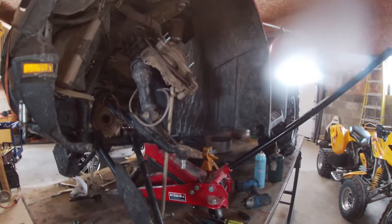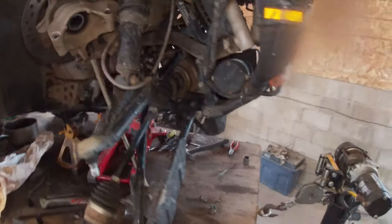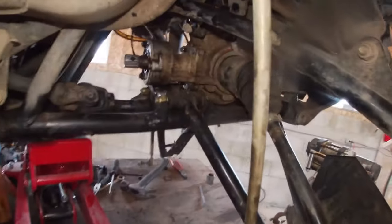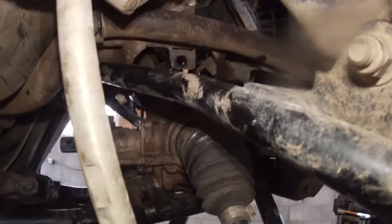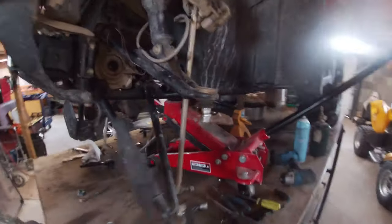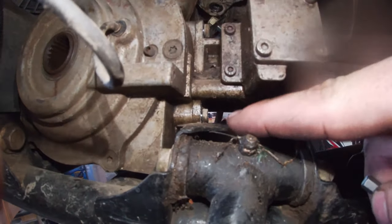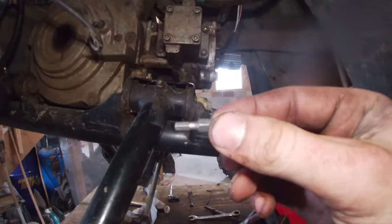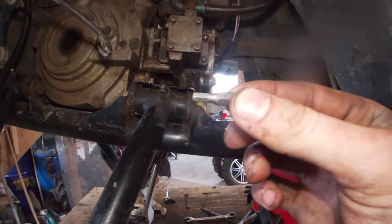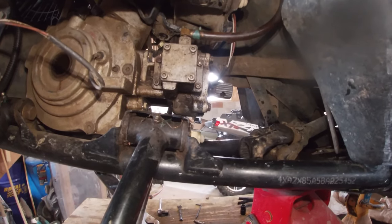What a fight! I ended up getting the axle out of one side but couldn't get it out of the other side. I didn't want to pull the CV joint apart, but I finally got everything torn apart enough. I had to take those diff bolts out so I could move the diff around, but I finally got those four millimeter allen head screws out. I ended up having to put the allen tool in there and then put a quarter inch wrench on it to turn it.